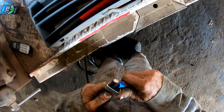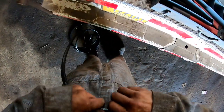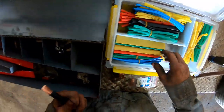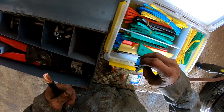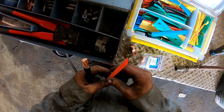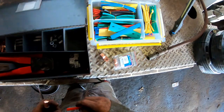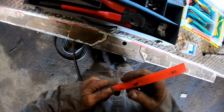First we've got some single aught cable. I probably could have gotten away with number four or number six wire, but on electrical stuff - especially charging type stuff - sometimes the bigger the better for current flow. Let's get a piece of shrink tubing. I'd like to get red but Fleet Pride only had black battery cable, so the way I'll identify the positive is I'll put a piece of red heat shrink on it.